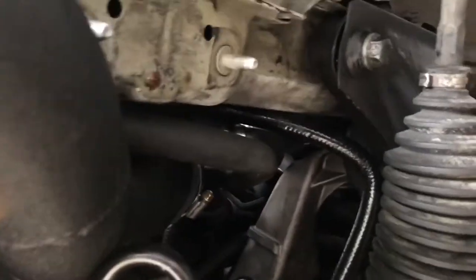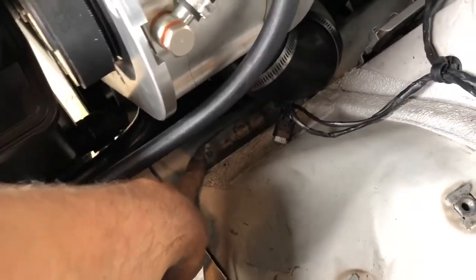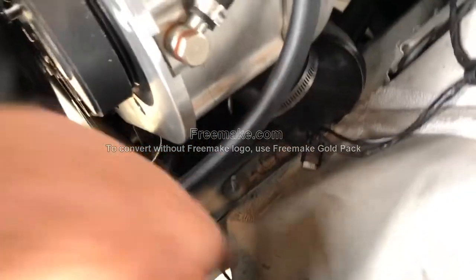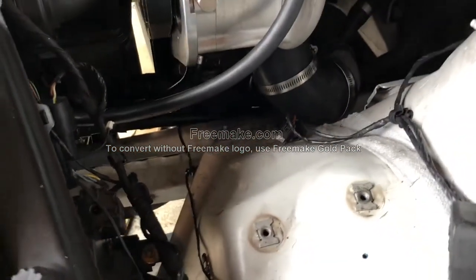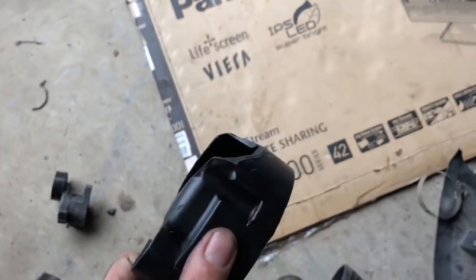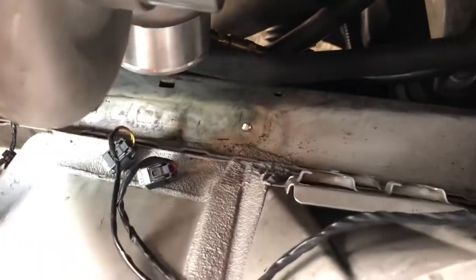The other thing I had to do is grind off and break off the little bolt that comes out of here, which is part of the airbox mounting system. So that's the back of the alternator — I've just cut the vent pipe off there, and also got the dremel in there and just ground down this little one of those protrusions.